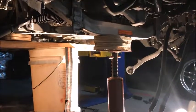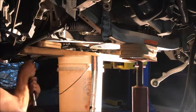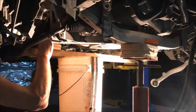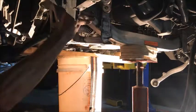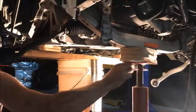Okay, we got round two going on here. Now we got our jack holding up the front of the frame, and we got a bucket, a board, and a transmission jack on the back. Now I'll take the bolts loose — I've only got one bolt left in there — and then let's see if we can lower this down enough to get to our power steering lines. Let's lower things down.